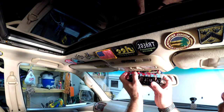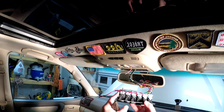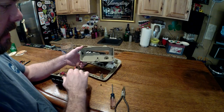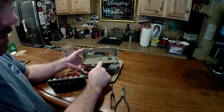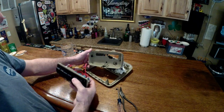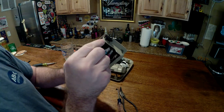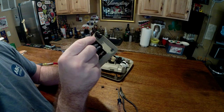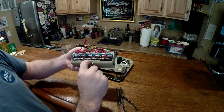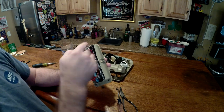I just realized that my flag connectors, if they're sticking out past these switches, there's the wall there. I originally didn't think I was going to need to take all this apart to get this in, but it was so hard. I needed to cut this extra access hole a little bit bigger to try to get the wires in there. I went ahead and took this apart — I didn't take all these connectors or the home link off, just enough to pull the sunglass holder out itself. This helped me identify the places where things were binding up or it wasn't fitting. One thing to note: this screw in this corner got really close to this gear and it actually made the screw tilt up a little bit. I ended up trimming right here to allow for all these ground wires, folding them down and electrical taping around the switches to hold those wires tight so that when I was putting this in, they didn't get pulled or yanked on.